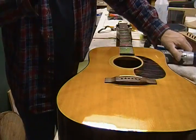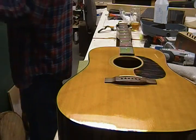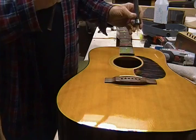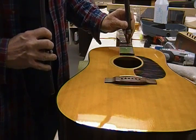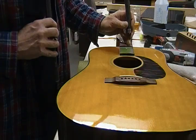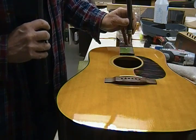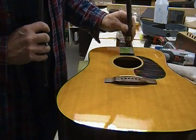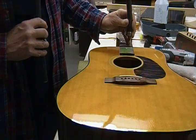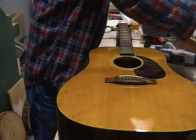I'm not going to be steaming this off in this session — it's after 8 p.m. and I worked all day before I got out here this evening. Just wanted to get this extension up and get these holes drilled. The needle is 62 thousandths — it's the same as a 4/64 bit. So if I used the 4/64 bit, or 1/16th bit, I would be press-fit into this hole, and that would be a drag because you don't want it that hard getting out. So it's a 78 thousandths hole — you've got a little over 10 thousandths of clearance there.